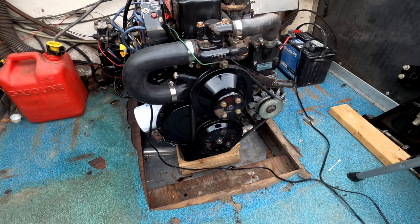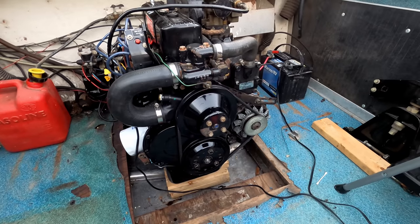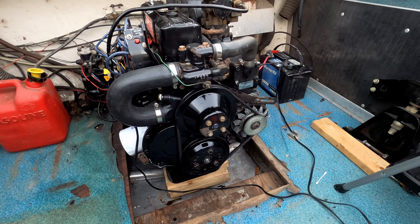So if you're going on trips and stuff like that with your boat, you gotta remove the motor mount completely to get another belt put on just by this particular design. So it's nice to go ahead and put another alternator belt on there, water pump alternator belt, and zip tie it off to the side, so it doesn't get tangled up in anything, obviously. And then when you do blow a belt, yeah, you obviously, if you're driving an older boat, you better take you some tools with you.